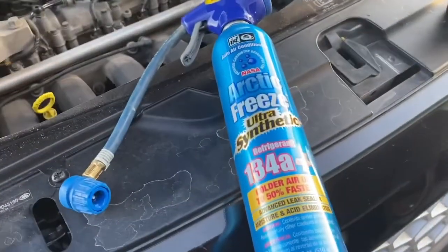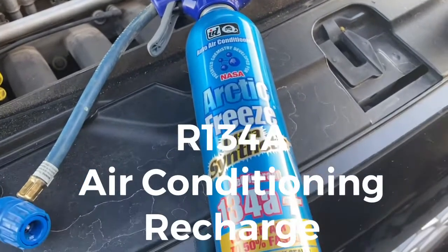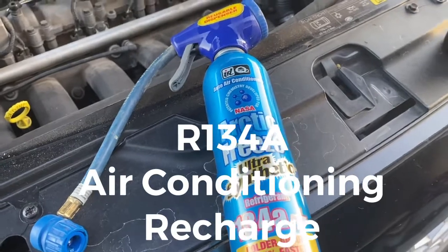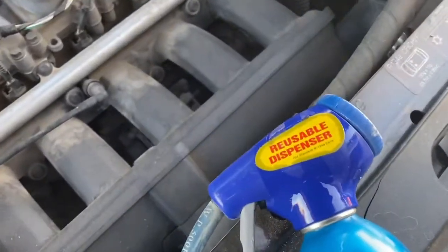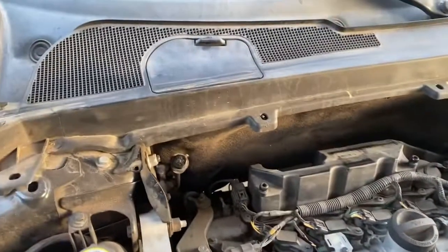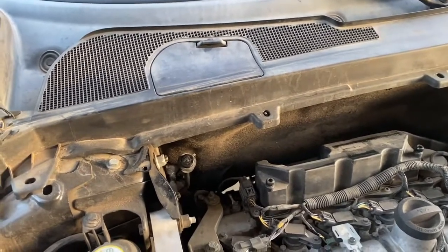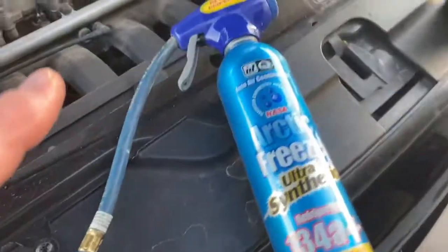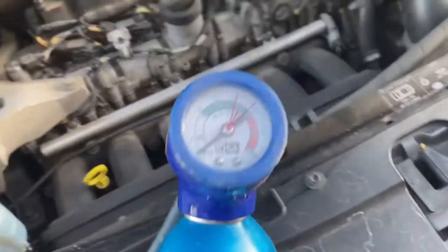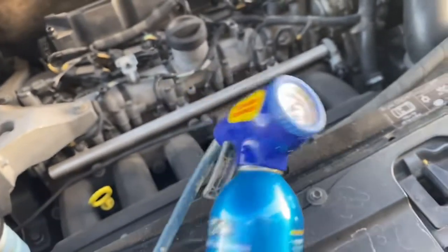That's where you're going to hook up your Freon or R134A air conditioning canister to do just a quick recharge. Extremely easy to do — read the instructions. You want to start your vehicle, turn your air conditioning on to full. You want to agitate the can, move it back and forth, up and down. Also you want to get one that has the actual gauge, because then you can see where you're at and what you're putting in.